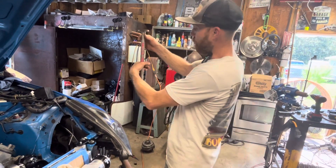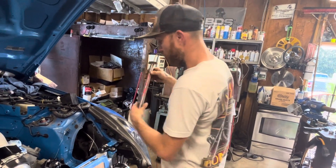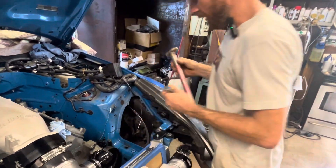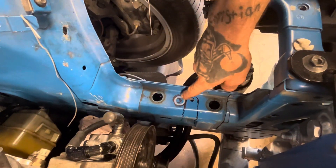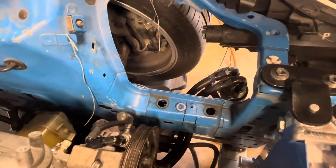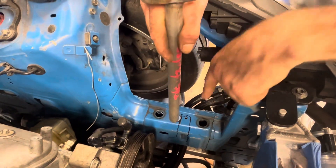Then I'm going to mount this to the turbo drain. I'm going to weld an AN fitting down here wherever it goes. I got it laid out right here. I gotta bust this little hole here and I'm going to drop this down through the chassis.